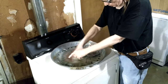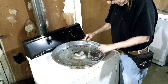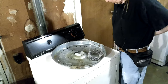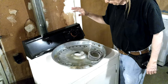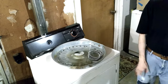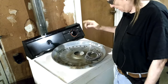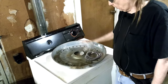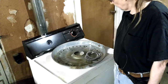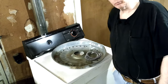The bottom side was grounded, so it was working as a 110-volt dryer instead of a 220-volt dryer. Then at some point — maybe we moved it or slammed the door — the rest broke off and nothing was touching the ground, so it didn't come on anymore. I'm pretty sure that's how it happened. I didn't think the coil was bad through my testing because it was coming on, heating up, and then tripping the overheat thermostat repeatedly while I was just sitting here trying to get ready to work on it.